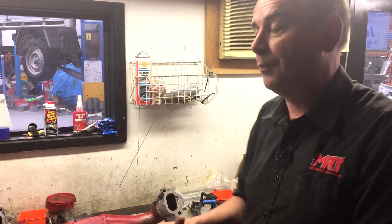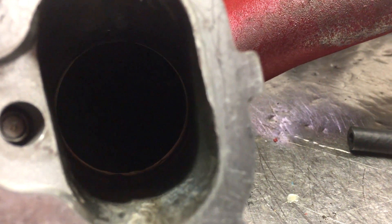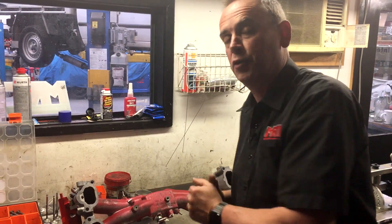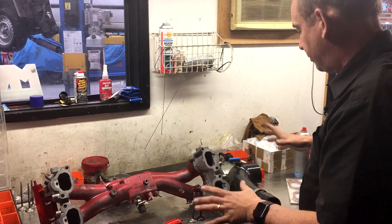Let's talk about the inlet manifold. Normally inside there would be an old-school choke or butterfly, but there's not one there at all — just a ginormous hole. These are the tumble generator valves, which Subaru put on the cars to help them pass cold-start emissions. They're electronically controlled via butterfly through the factory ECU, and they're a restriction for high-performance mods, so you can bore them out and delete the TGVs, or you can buy the Process West billet kit that bolts on.